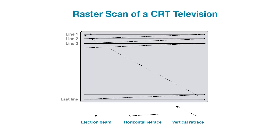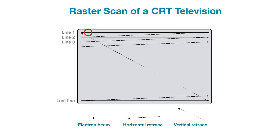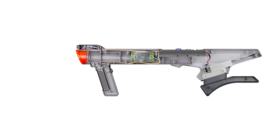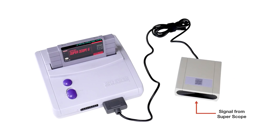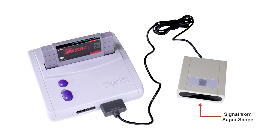The SuperScope tracks a player's aim with the help of four separate components: the light gun, the infrared receiver, the game console, and a CRT television. Unlike LCD or OLED displays which show an image all at once, CRTs draw from left to right and top to bottom, and only one small spot on the screen is brightly illuminated at any given moment. When the SuperScope is aimed at the point being drawn, the photosensor picks up the light and sends an infrared signal to the receiver, which tells the SNES what screen coordinates the gun is aiming at. Without a CRT drawing its image line by line, there's nothing to produce that timing.